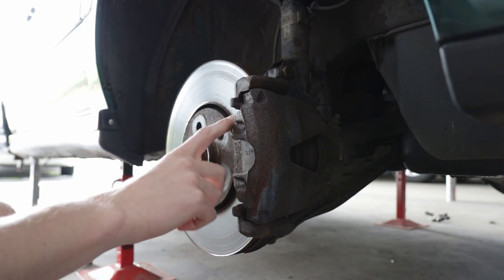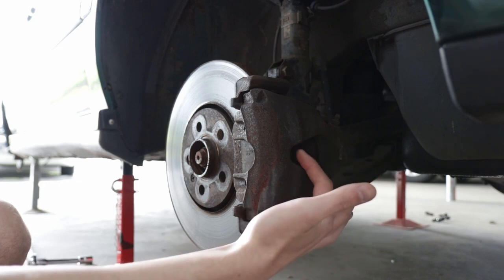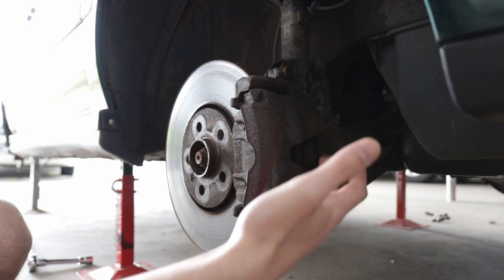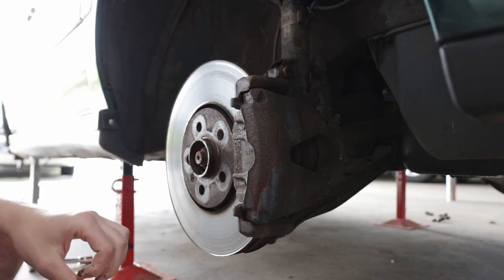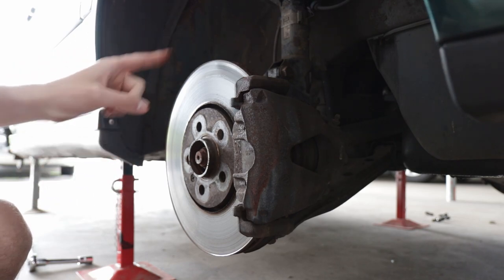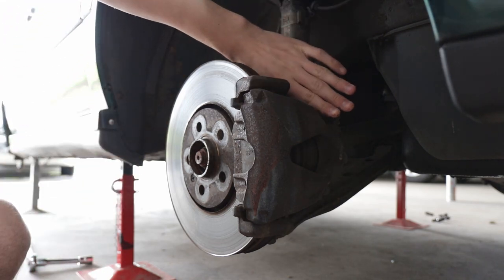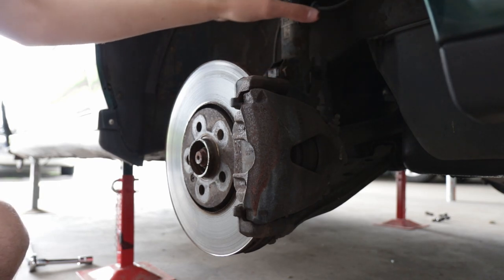But if you've just put pads in, please mask off the pad — it just looks a lot better that way. Back here, this little section is where the pistons are, which compresses the pads onto the rotor. We don't want to get paint in there, so usually what I'll do is just put a bit of masking tape over this section. As well as that, I'll try and cover as much of the rotor as I can. Obviously you'll get some on the rotor and when you brake it'll go away — that's fine. But if you get it stuck on the face, you'll forever see it spinning around when you've got the wheels on the car. We'll also cover up all the back section — let's not paint the suspension, the brake lines, or any of the undertray.